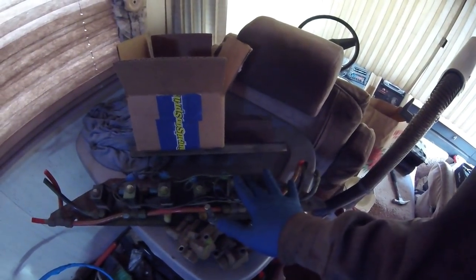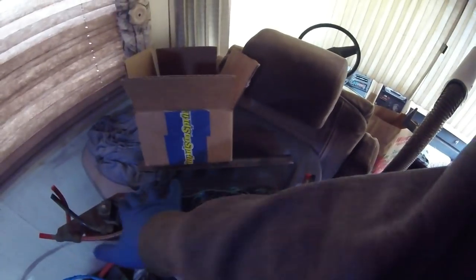I also liked the automatic switch, which was basically an on/off for the line going out to the airbags. You turn that off and the thing will stop trying to level itself, but I can't really find a reason why I need that, so I'm just going to keep this stuff out for now. This would be good for a project later — repressurize this and just use it as a manifold for accessories like an air horn or purge valves for the tanks. There are two expansion tanks and a main compressor tank, so I could hook up some timers to them — a project for the future.